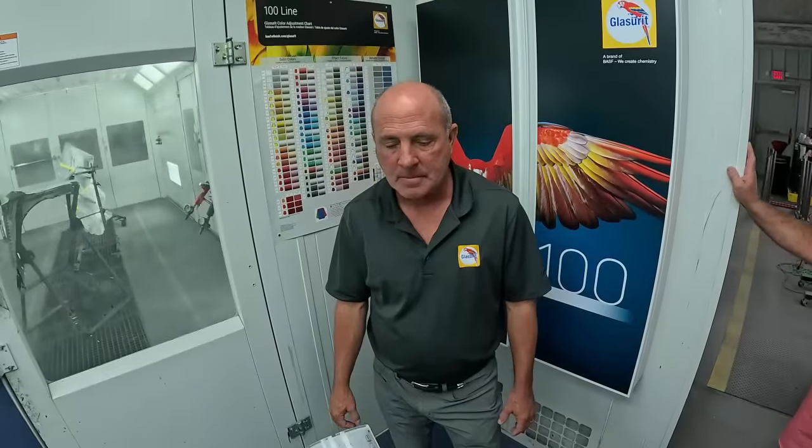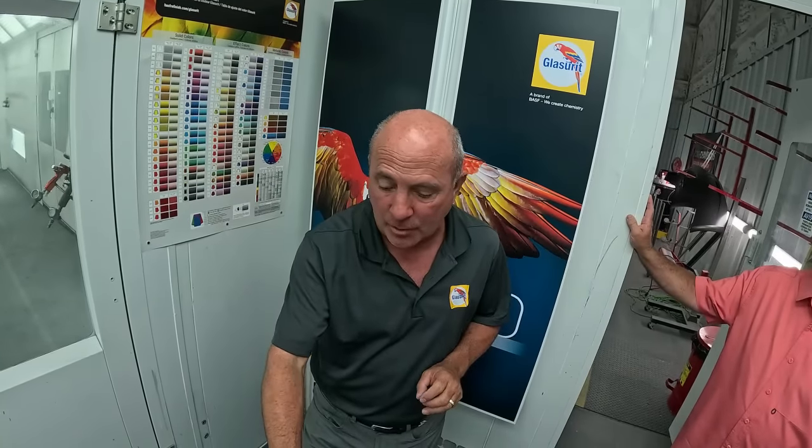For characteristics, I wanted to ask him about adhesion, is it direct to raw plastic or to bare metal and all that? Let us know about that. This sealer is an AdPro sealer. It has adhesion promoter built into it and it's pre-flexed. So it can go over raw bumpers, prepped and treated right. Right, and it can go over sanded e-coat. One sealer does everything.